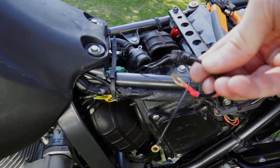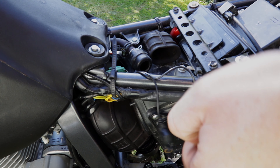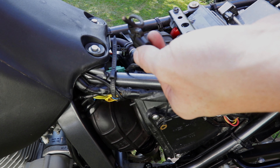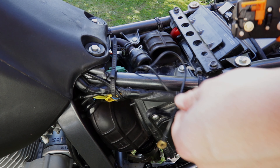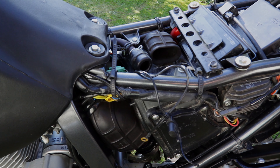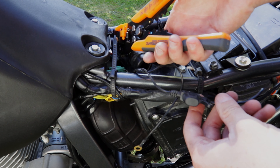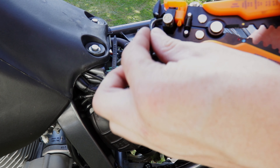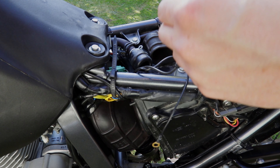So I've got my two ends here off the battery terminals — you just want to snip them off. Now you want to keep the fuse that was originally in there, the inline fuse. That circuit is fused but it could be on a different amperage than your actual accessory, so you always want to keep your accessories separately fused.